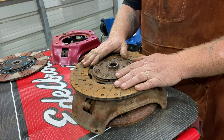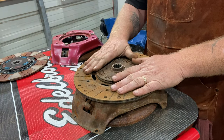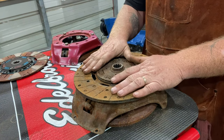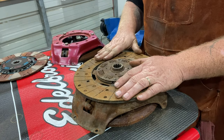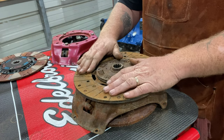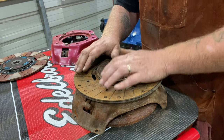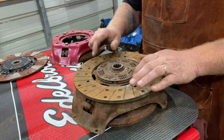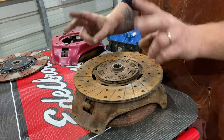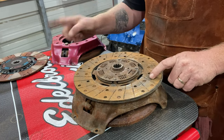If you've got a street car and you want to play with it, and you try to upgrade from this bone-stock production stuff, with power and clutch dumps it will cause it to slip and will eventually burn its material up - especially if you're trying to stage and bump it in. This material will not last. The term 'rotting your clutch' - it eats these up. You have to upgrade.